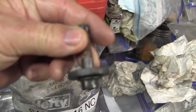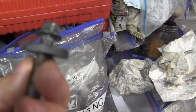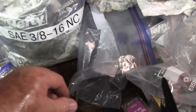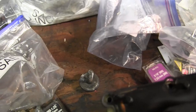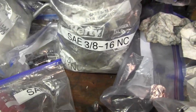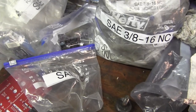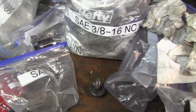I'm thinking that this spring washer — it's a special washer — I need to get another one because I don't know if this one has lost its spring. It doesn't seem to be compressing the flywheel onto the crankshaft enough, and a flat washer won't help. This bolt is deformed, so I need to find a 3/8-16 bolt to replace it. It's really old, since 2003. It appears it might have lost its tension and the engine doesn't want to start anymore, so I've got to replace that bolt.